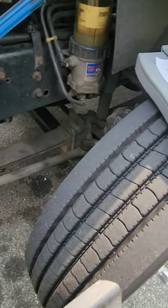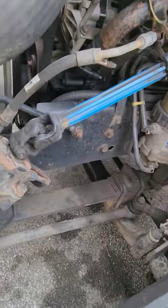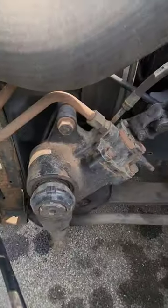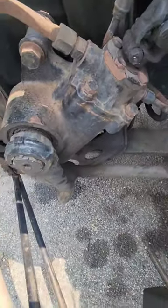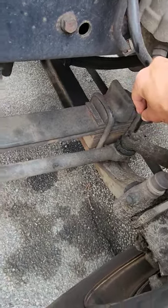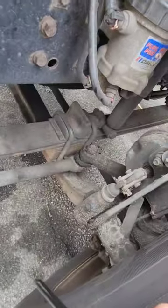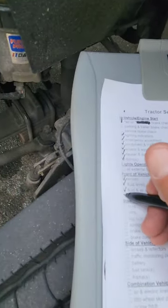Okay, steering systems, which would be the entire steering system. Steering shaft, no more than 2 inches of play. Secured with U-joints and is properly greased. The hardware is present. Secured to the steering gearbox. This is not cracked or leaking. It's not damaged. Secured to the frame. My pitman arm, my drag link, my steering knuckle, and my tie rod, which is the straight bar down there. All secured with castle nuts and cotter pins, and they're properly greased. Okay, let's go back, check the steering systems. That's good. So steering system is done.